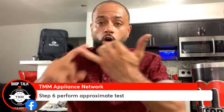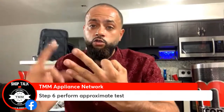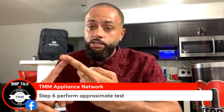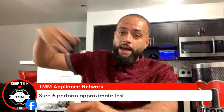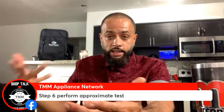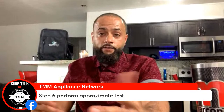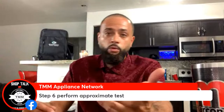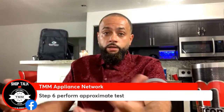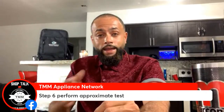Some tests, you've got to do an ohms test. Sometimes a voltage test. Sometimes a capacitance test. Sometimes you've got to turn something. I've done tests on washers where I have to turn the basket to test the Hall sensor. So you have to know what the appropriate test is. I found the circuit, Brother B. My heater, my defrost, my board, my wiring harness. But now what? Now you have to perform the appropriate test, okay? And in that test is where you're going to find your culprit.